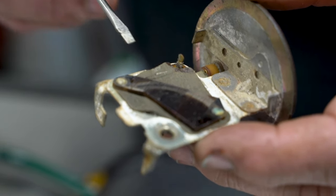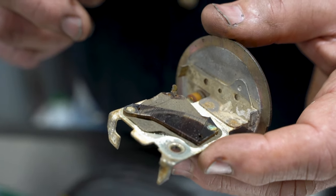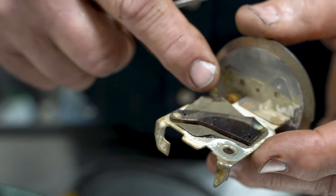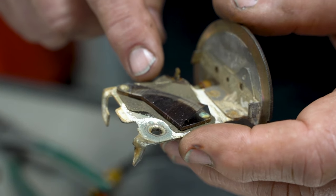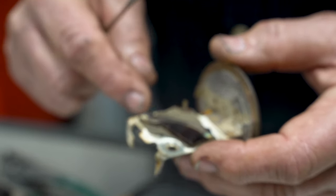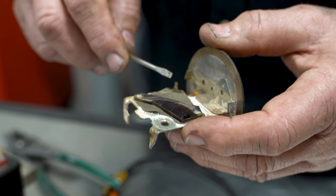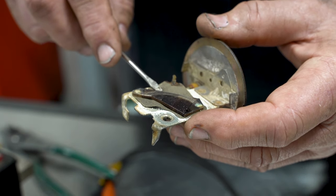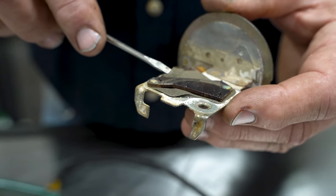You can't solder this wire — it's a resistor wire, it won't take solder. Instead, take a thin single strand of 16-gauge wire, make a loop, put it around here, put a loop in the other end of the wire, then take this wire and put it through that loop and solder it. The solder will stick to the copper wire, surround this wire, and restore the connection. So you can sometimes repair it if this wire is broken.